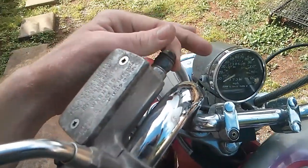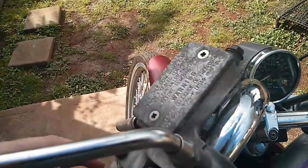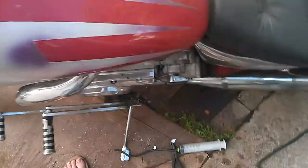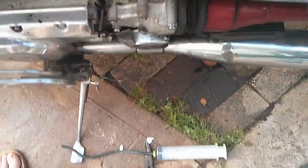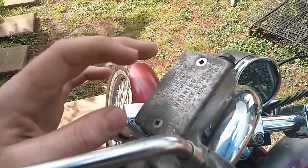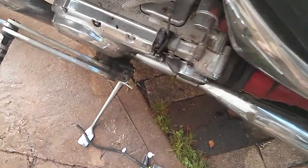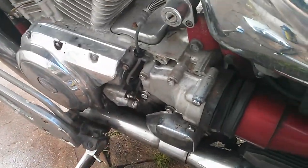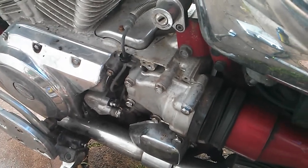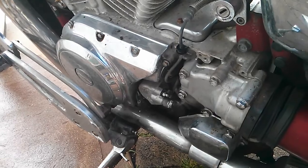Come back up here and close the banjo bolt, and have the reservoir cover off. Then open the bleed screw back and keep filling up with fluid until you see fluid coming out of the reservoir. When you see that, close up the system. You should feel a little bit of pressure the very first time you do this. After you close up the system, you can go back to bleeding it like normal.